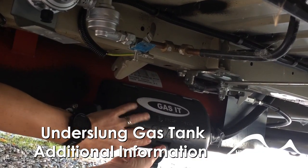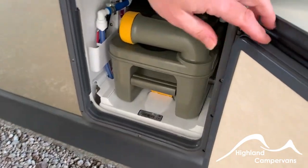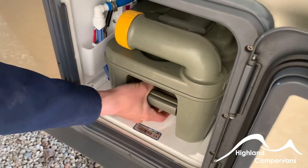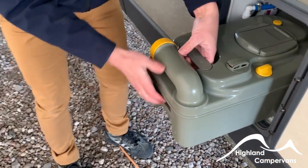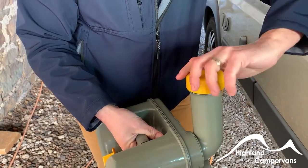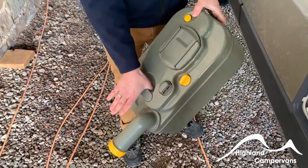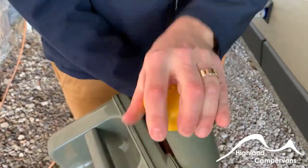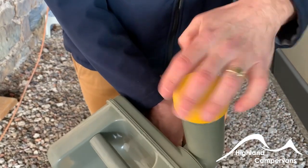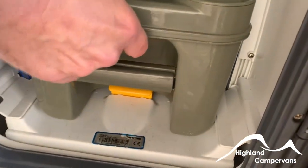Push the plastic clip firmly back home. For the toilet cassette, unlock the doors, flush — water comes directly from your onboard fresh water tank. Pull up on the yellow lever at the base and slide the whole cassette out. If you feel resistance it may be because the slide hasn't been shut properly. At collection points on a campsite, take the yellow cup off the top, tip the whole thing up, and press the yellow button at the top of the base to allow airflow in and waste out the bottom. Before loading it back in, there's a measuring cup inside the top of the cap — add up to a cap full of green chemical mixed with about two litres of water, then slide the cassette back in until it locks firmly.